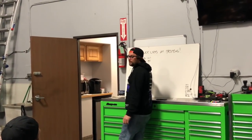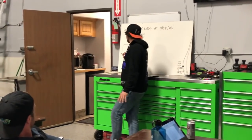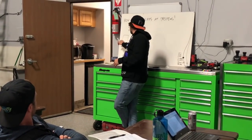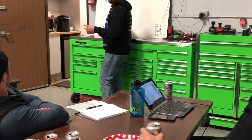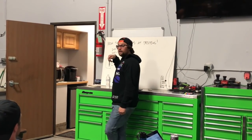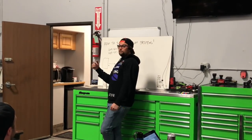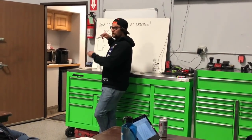On S13, it's about 90%. So that means your 10K spring in the back, which I'm not saying anybody should run 10K, just 10 is a round number, would be about a 9K spring because it's about 90% of its use. Meaning this has a slight amount of leverage on where that is. Now, in the back of an E36, your spring is about here. It's at 59%. So your 10K spring is a 5.9K spring. So now, my S-chassis homies, they run 5K spring in the back. A 5K spring on a BMW won't even hold the car up. It'll just compress it all the way.